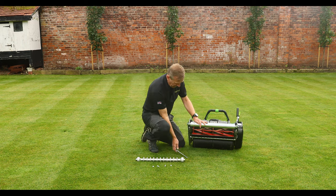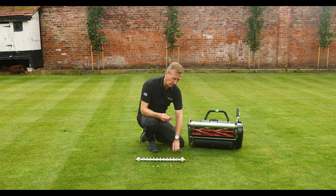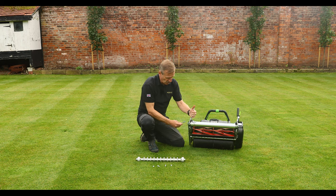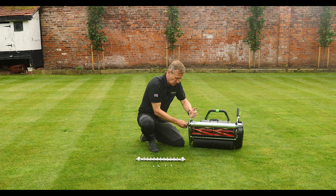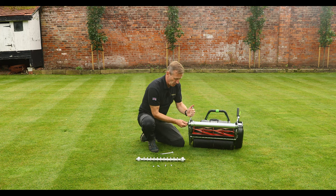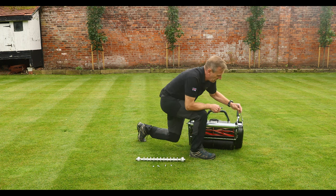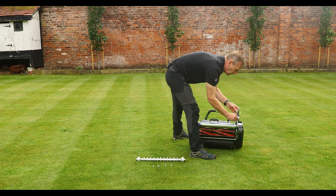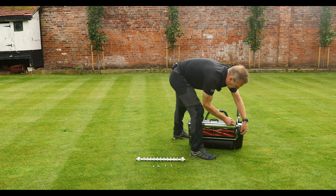With the Stirling and the Liberty that's not the same issue, and what I'm going to do is use the two spanners. The 17 millimetre is going to hold the stub shaft still, and I'm just going to undo the small studs using the 13 millimetre spanner. I'll leave that supported — 17 millimetres goes here, 13 here.